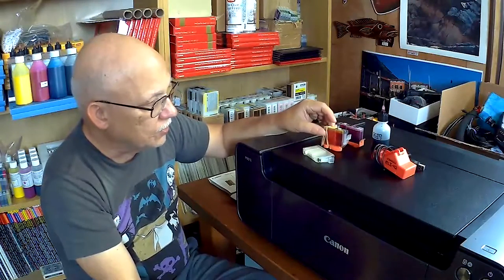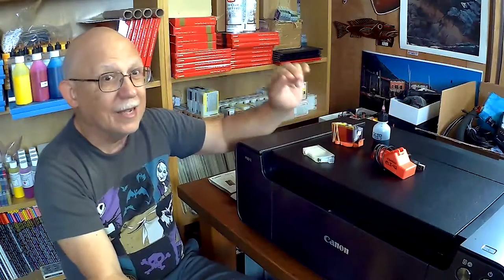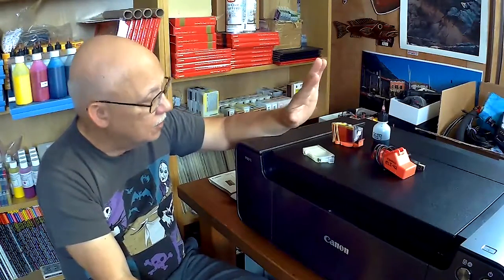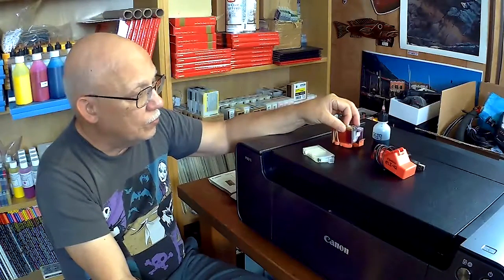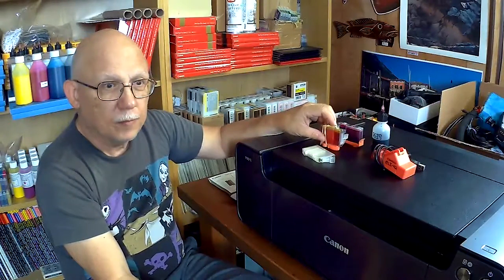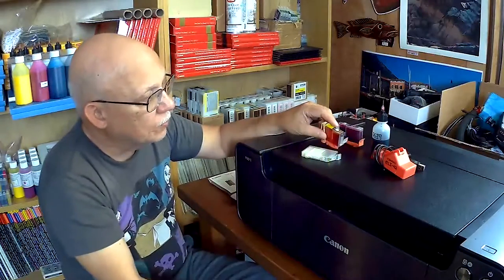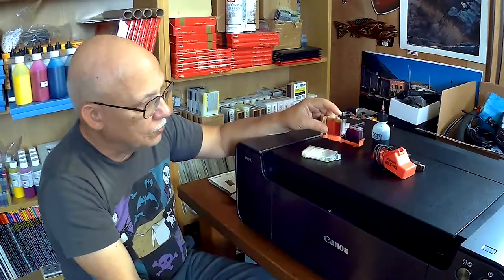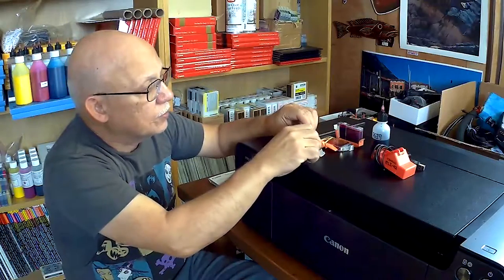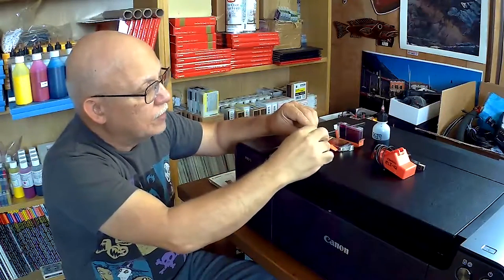You will receive your original set of setup cartridges in your printer — go ahead and use them up. I recommend buying a second set of empties from eBay; they're available for two to three dollars a piece. Those can be used as a backup set, which you will then refill with Precision Colors ink. You will have to remove the factory-filled ball, plug it with one of their plugs, and that will allow you to refill.